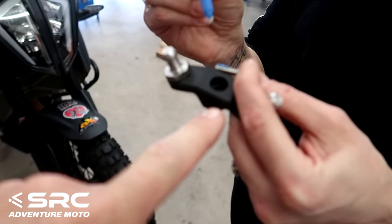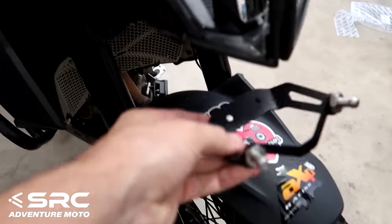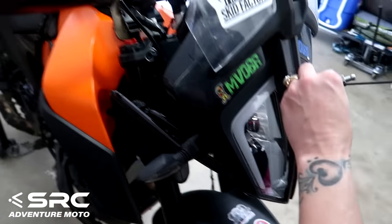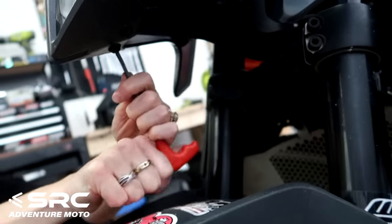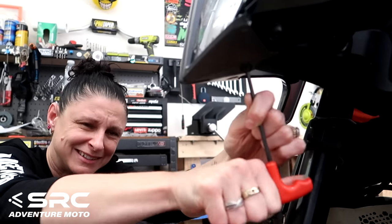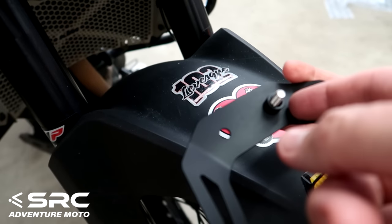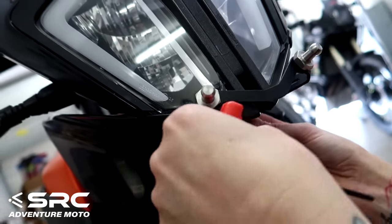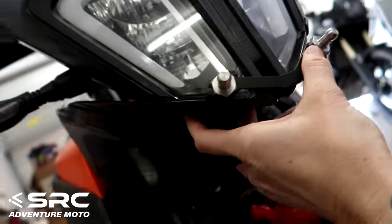Alright guys, so we've got two brackets to install to the bike. This little one here goes on top of the headlight there, and then this other one mounts up underneath there. We'll get to that in a minute. There's thread lock on everything, of course. Two bolts under there to undo. I always muck that up every time. Hard when it's upside down. Righto, so we've got a threadlock bolt up through the hole there and a little plastic spacer. Obviously we're just bolting that into where we removed those other two bolts from.